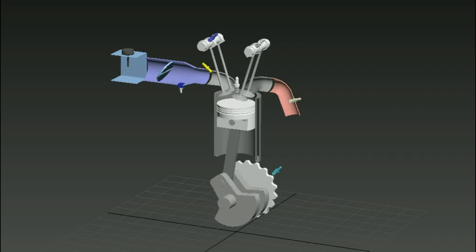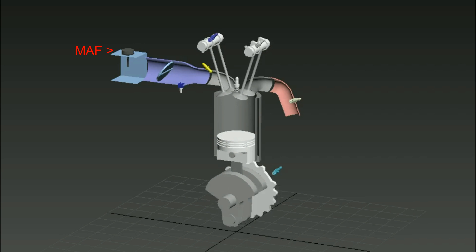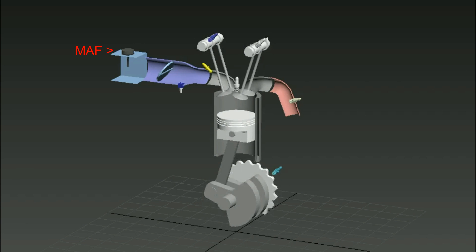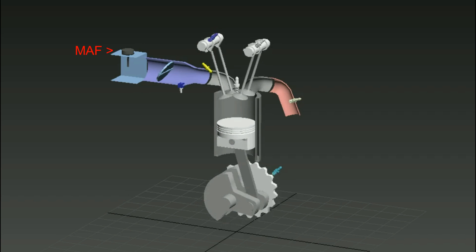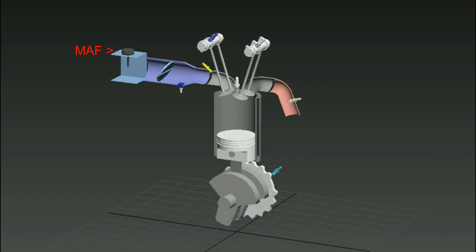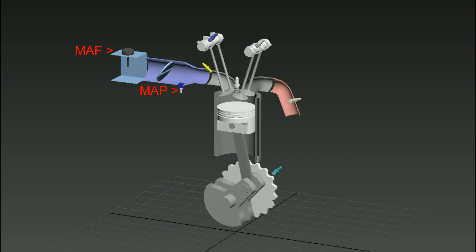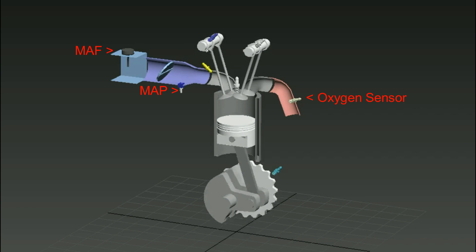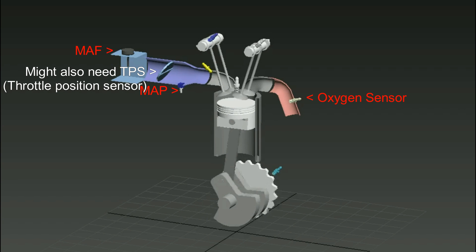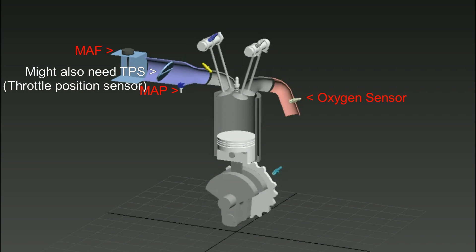Some additional sensors you might need to connect — which entirely depends on your car — is the mass airflow sensor. Sometimes when the ECU detects that you're running too much airflow, it might retard a lot of ignition or cut power completely. So you might need to change the values from your mass airflow sensor going to your stock ECU to fool it into thinking you're not running extra boost. The same way, you might also need to tap into the manifold pressure sensor circuit, and you might need to tap into your O2 sensors, because in closed loop mode the ECU will always rely on the O2 sensor and change your air fuel ratios according to that.